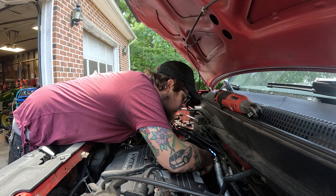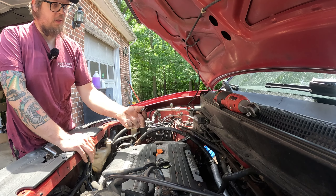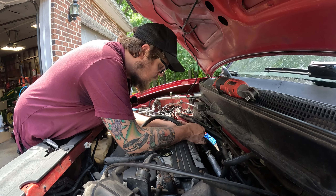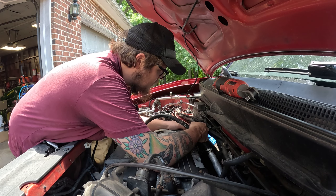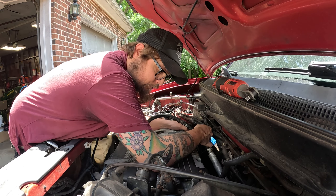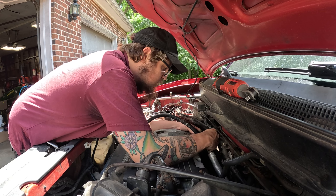I just got the VTEC solenoid bolted down and plugged everything back in — two clips on top, one and two. Easy peasy. Now that's back together, we can go ahead and throw that old gasket away — that thing is flat as a pancake. If you're a torque spec kind of person, you definitely don't want to tighten those bolts too much because you will strip the head. Tight is tight — you just got to squeeze the gasket. It's only a 10-mil bolt, so torque specs are tiny. Keep that in mind. Also, when you're taking it out, it shouldn't be super tight.